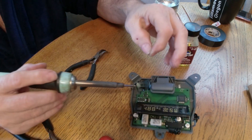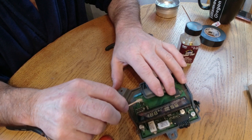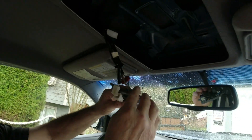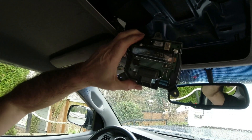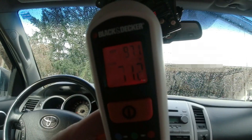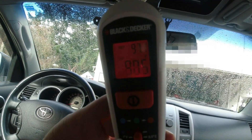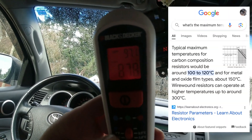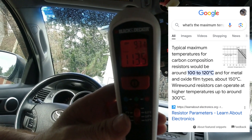Repeat this entire process for the second lead of the resistor. Okay, let's go see if this thing works. Go outside to the truck, plug it in, turn the key on. And... does it? Yes, there it is — it works! And since I made a small modification to this circuit design, I'm going to break out my thermal imaging gun and see how hot this thing gets. Looks like that new resistor is getting up to about 116 degrees Fahrenheit. Since metal film resistors are good to about 150 degrees Celsius — right around 300 degrees Fahrenheit — we're well within the operating tolerances of that resistor. I'm going to call that a good fix.